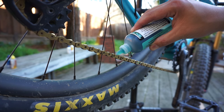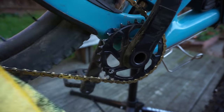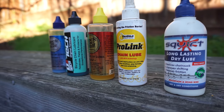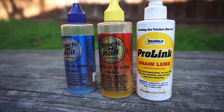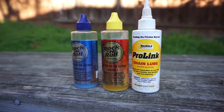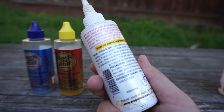After just a few rides, I wipe my chain clean with a rag, along with the pulley wheels and the chain ring. Now at this point, when it comes time to reapply lube — and this is very important — I never apply a heavy lube again. I found that this often leads to some pretty bad gunk, which is incredibly abrasive. So instead, I reach for one of these lightweight lubricants, which is really good at supplementing the base lube. These are easy to identify — they're really thin and can often leak out of the bottle as soon as you tilt it.